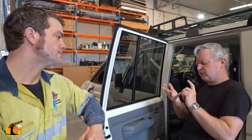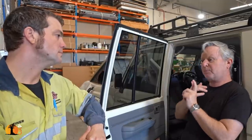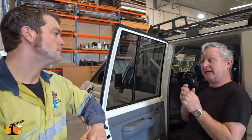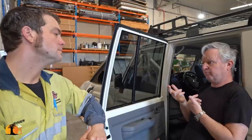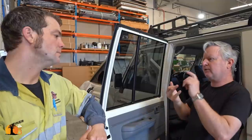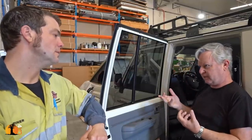Yeah. This is one that's very important. Keep the number of connections as small as practical. Yeah. And I've seen systems where they had unnecessary cutoff switches, but the end result was, yes, you had a cutoff switch, but you actually had quite a big voltage drop because of them, because they were a little bit too small and the connections weren't great, et cetera. Yeah. So minimum cable length, minimum number of connections, no unnecessary connections. You agree with that? Yeah, absolutely.